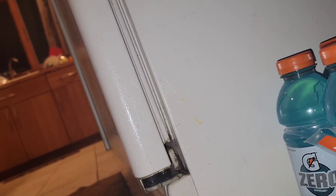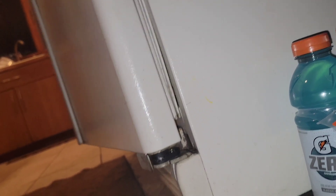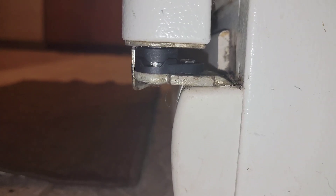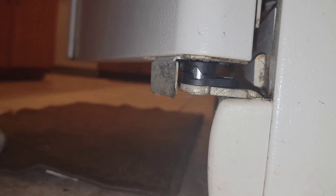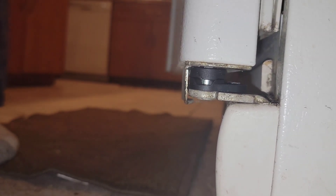It's that cam — it's how it's riding up in that little gear right there. It's not seating down inside it all the way. So that's an educated guess. The bottom cam has to rotate in a little bit — I could loosen that up and see if I can move it ahead and re-tighten it, or try one of the other bottom cams. See how it's high right there? It lifts up and doesn't want to sit down in there all the way. It almost seems backwards, but it's not.